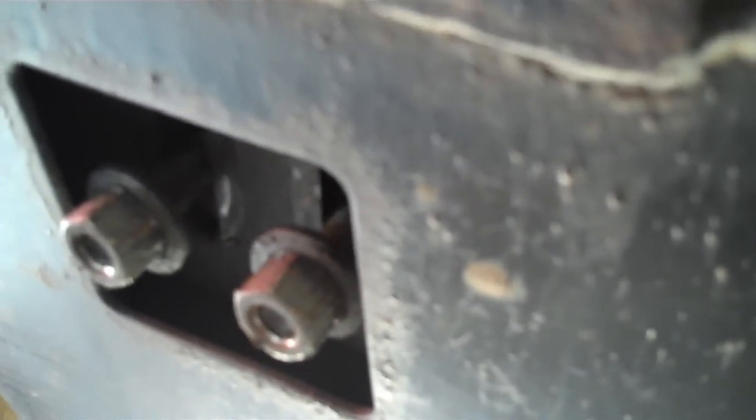This right here is a torque arm that sits up above. When the motor torques, it pulls up on that bolt — it cushions the rotation of the transmission and transfer case. First thing you want to do is take that off, then take these two out which hold your transmission and transfer case mounting. After you get the mount, then do the others. Be careful — the transfer case is not exactly a featherweight, so either have help or put your jack under it when you bring it down.